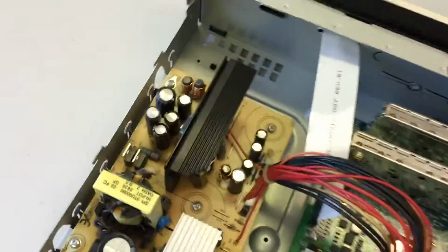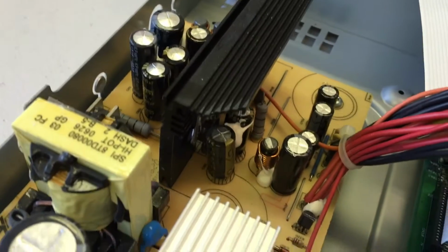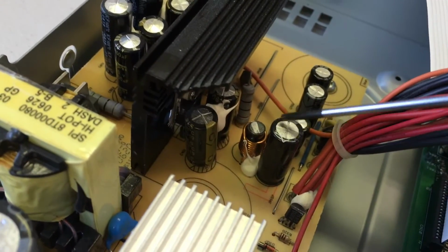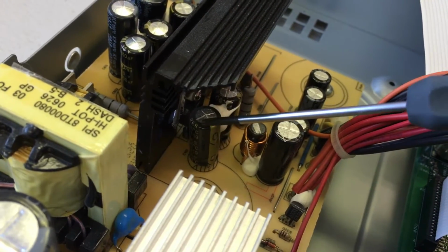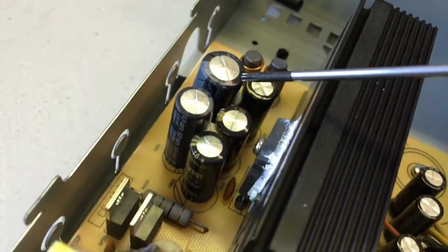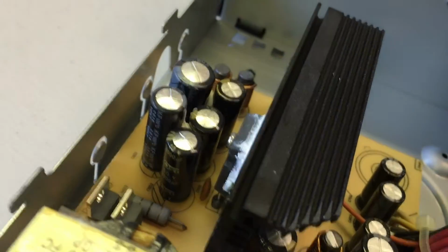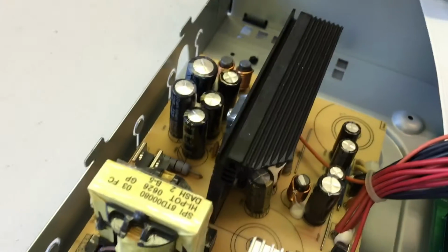Before we go further, let's look at this power supply and we'll get an idea of why we're replacing it. So these cylinders over here are called capacitors, and this is a capacitor that looks just fine. It's got a flat top to it. But this capacitor over here, for example, has a dome top, as do 4 of these 5 capacitors over here. The tops are bursting open, they're a little bit domed, and you see this 5th one back here is actually still good and flat.